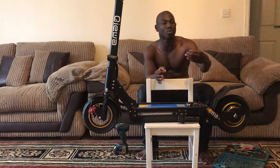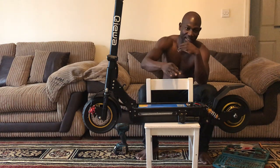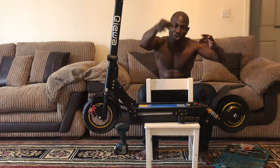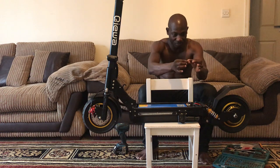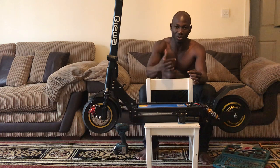The cable system is what we're keeping. The controller is what we want to get rid of and put a new controller in. So when you take that first cable out, you hold the one that is the cable system. You take your new controller, you look for the same cable that you've just taken off the old one, then you connect that one. You take the second one, you do it like that. You do it gradually, one to one.